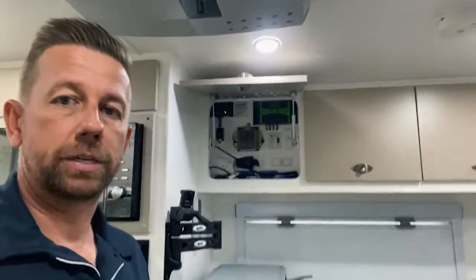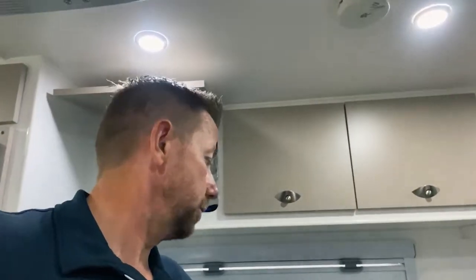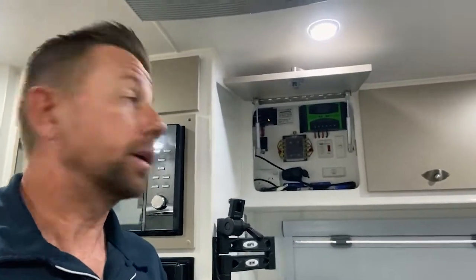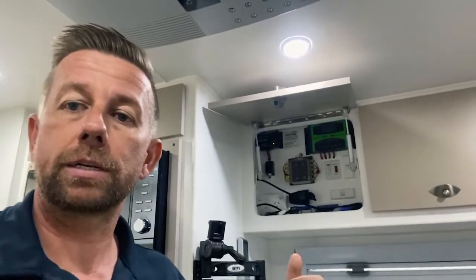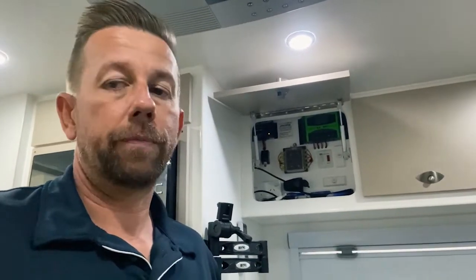Here we are inside the Kokoda. We've got a standard control cupboard that most vans have. Up there we've got a 30 amp PWM solar regulator - that was fine with two 150 watt panels, 300 watts total - but we're going to upgrade it to the Morningstar EcoBoost 40 amp MPPT regulator. We've also got a BP400 battery protector, which cuts voltage when it drops low for AGM batteries. Since we're converting to lithium with its constant voltage, that becomes redundant so we'll disconnect it and either remove it or leave it to fill the space.